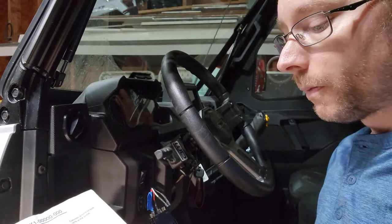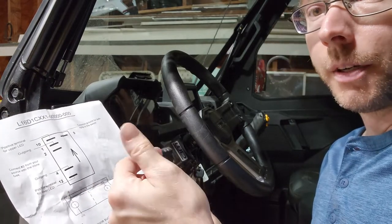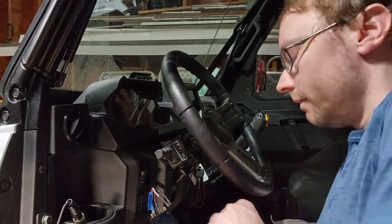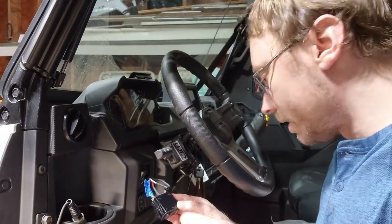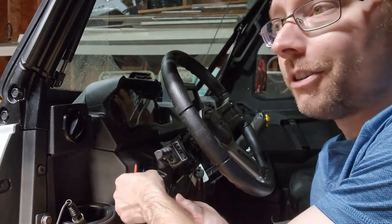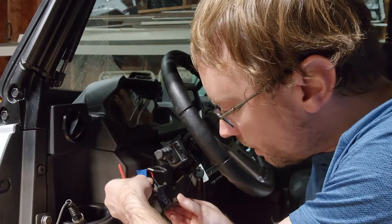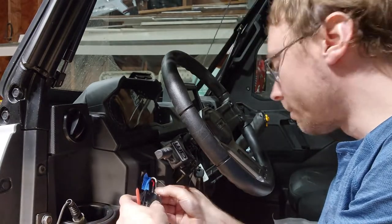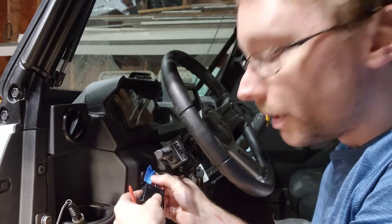Next, we have pins number one and number four, both labeled as the same thing: outgoing to the relay, accessory, or equipment. In this case, I'm going to use one to power the low beam side of the light, and the other one to power the high beam side of the light. You just have to make sure you hook to the right one to get the right position. On this switch, I know that pin number four is going to be the out for the high beam. You can just trial and error this. If it doesn't control the right side of the light, you just swap them. So I'm going to hook the high beam up to pin number four as one of the outputs. And then my white wire, which I know controls the low beam side, is going to go to the other pin, pin number one, which is this pin right here. That's going to control the low beam side of the light.